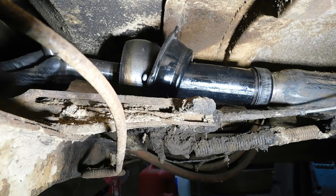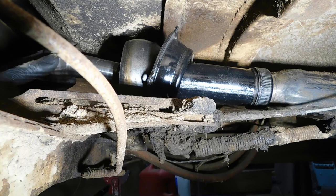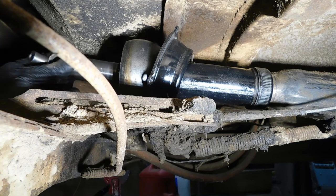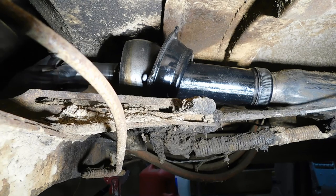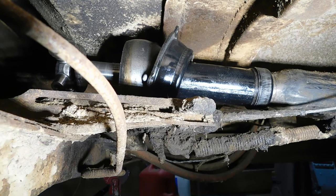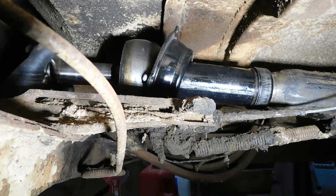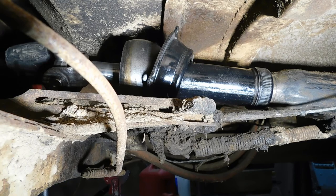I'm going to slide the yoke, with the U-joint, the trunnion in it, on. And I'm just going to kind of roughly match what's going on with the transmission, the angle. So roughly there. And then when I'm bolting the two together, I will jack up the rear axle and turn it slightly if I need to.